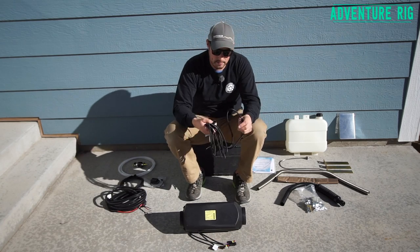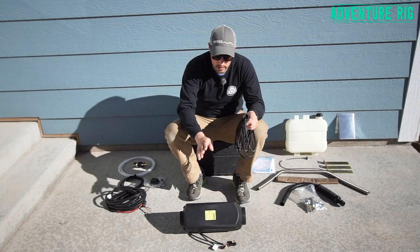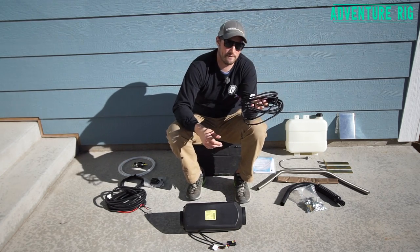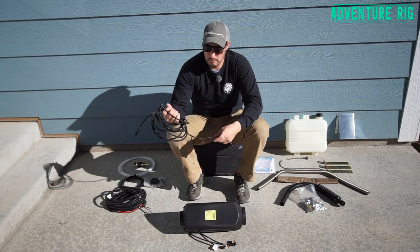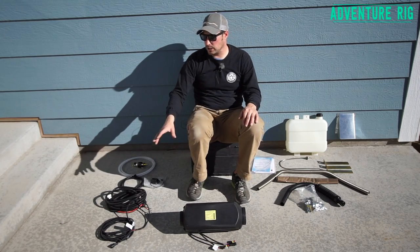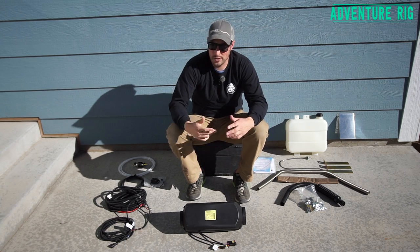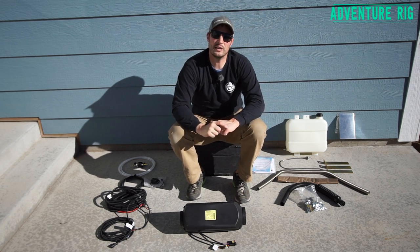Last but not least, you have this electrical wiring here, and it runs from the heater to your electrical pump to run that guy. This one's coming in at about 19.5 feet. Again, if you needed to splice into it, you could, but 19.5, pretty dang long. I found on the last application I had a ton of extra on that, and I think I'm going to be the same again on this one. So that's fine. We can make do, coil it up, whatever you need to do.